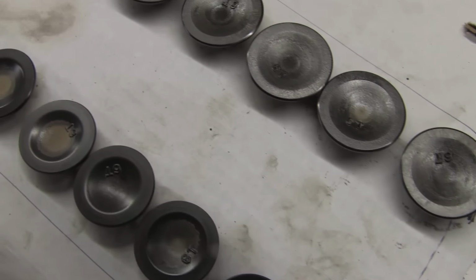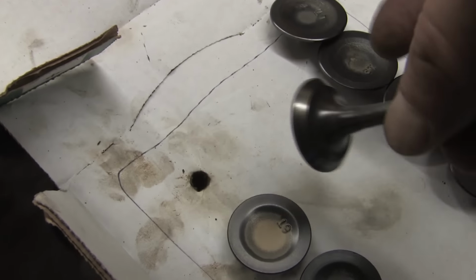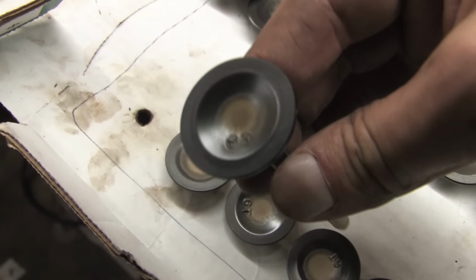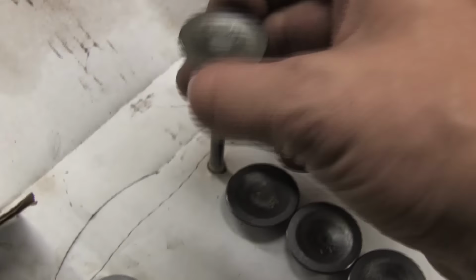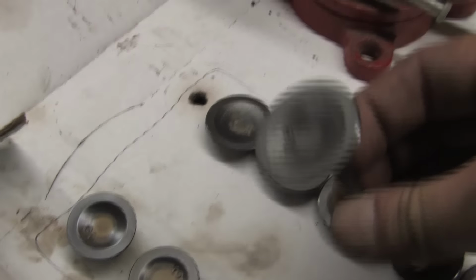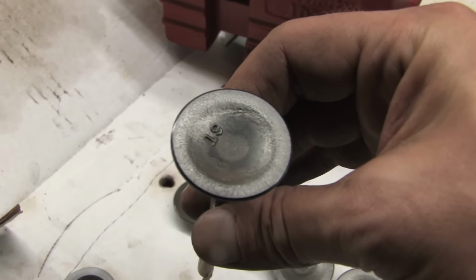These cleaned up beautifully despite what I thought they'd look like. The exhaust valves were the worst, and there's nothing wrong with any of these valve seats. If I wanted to spend some more time doing anything, I'd use emery cloth on the faces while they were in the drill and clean out the carbon from the recess part. And I'd also clean right up to the edge of where the valve guides contact on the stems. But you don't have to, it's just going to come right back.